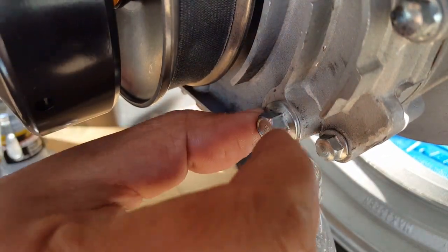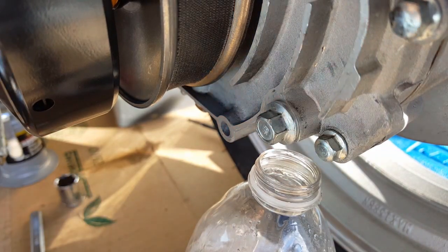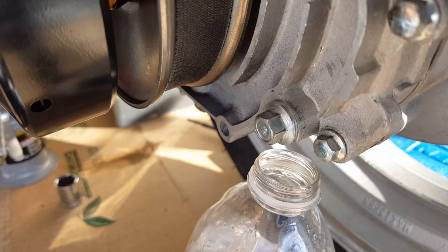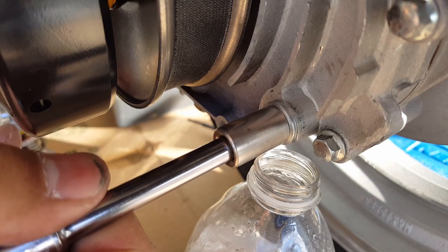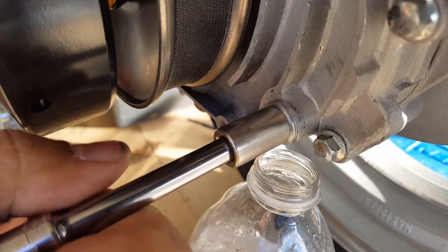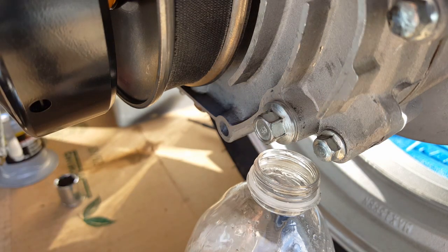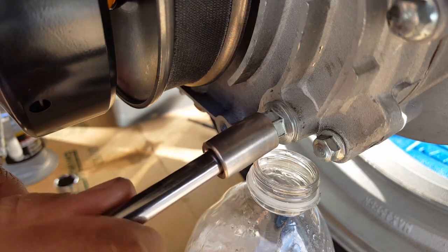You can see it conforms right there, so he's good to go, ready to be tightened down. He's going to take an M10 — that's why we brought the M10. The M12 was to drain it out. Now, since M10 is most likely an M6 thread size, or M8 at the most, I think it's M6, so you probably don't want to do more than seven foot pounds.